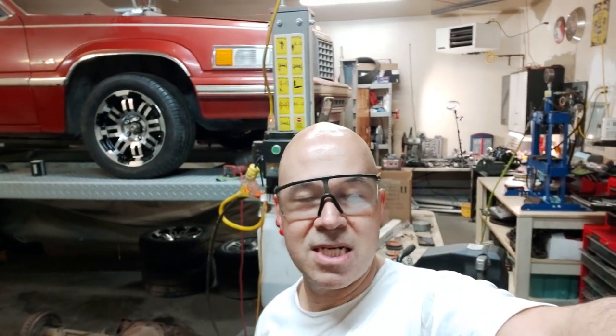So there we go, guys. Just another video of intake manifold preparation using the factory truck intake. It's not pretty, but it works. Boosted application doesn't really matter. As long as it holds pressure, we're good. So yeah, we got all the sensors in there, tested the injectors, 1500cc snake eater style. They're not from snake eater again. And we put some air pressure in our fuel rail, and I think it was actually 50 psi. I misspoke there saying it was 80, but I looked at the gauge again and it was actually 50.